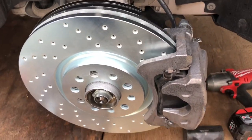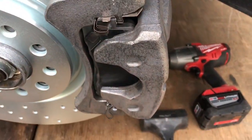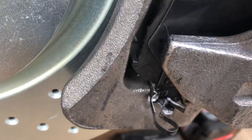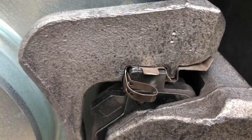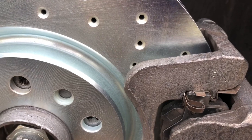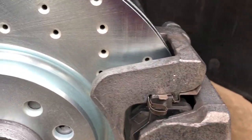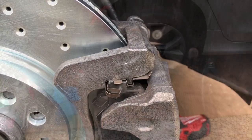Brakes are completely back together now — we have our caliper mounting bracket, our caliper, our pads. We did put some anti-seize onto the slide positions for the pad contact points, just to make sure we don't get any rust built up, because the chrome coating on those sliders is no longer there. The new set of brakes does not come with new clips to go onto that caliper bracket.